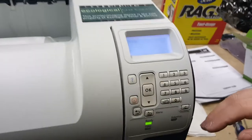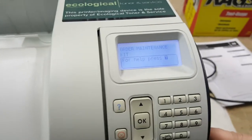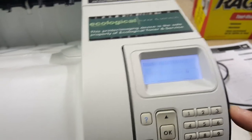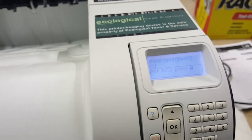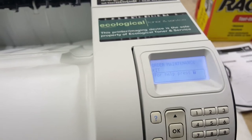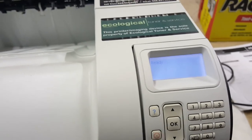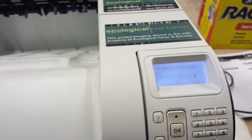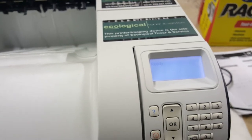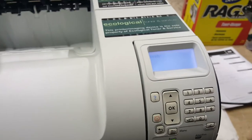Generally, you'll walk up and you'll see it go to ready, but then it'll also flash the order maintenance kit mode. A lot of times this is just going to hit at certain page intervals. When this comes from the factory, it's set at 225,000 pages. When we get into the service menu, you'll see that you can set that maintenance interval to whatever page count you want. This one is probably set to the factory settings, so we'll go in and show you how to manipulate this.